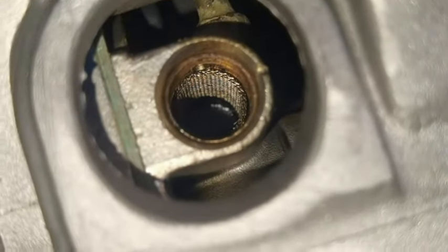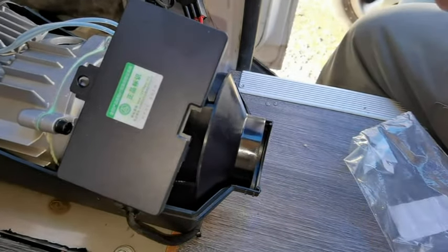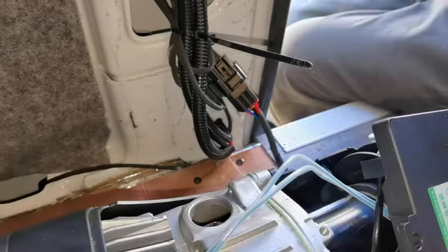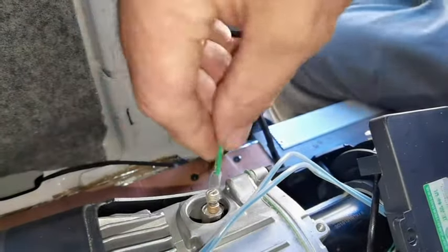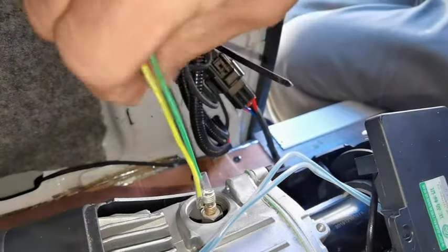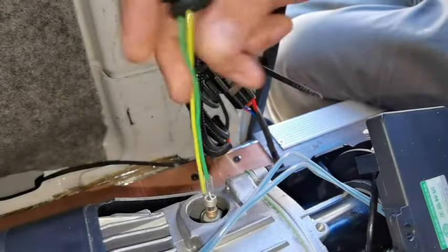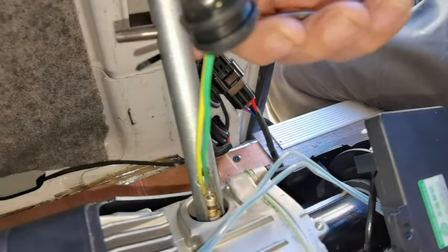It's all quite clean, so I'm going to change the heater plug anyway. You can buy these complete kits off eBay - brand new, about 16.99, and that includes the atomizer. New one going in - pretty straightforward. Make sure you don't cross-thread it, just use your fingers. Nice and gently because it's ceramic. You don't want to tighten it by the wires, just pinch it like that, then get your tool back and just nick it - don't over-tighten it.